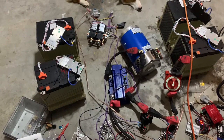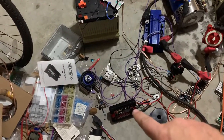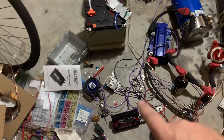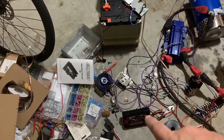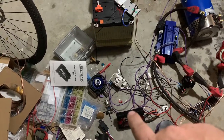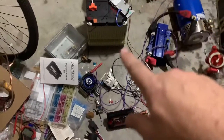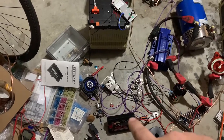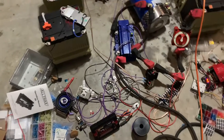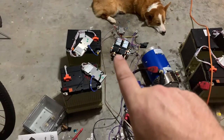The next step — I need a wire going from here over to the forward and reverse switch, and I also need both forward and reverse going to the potentiometer. But I can't have the two wires connected in any way that would always make it go in reverse or always forward. Basically what I need is two diodes so that the forward and reverse lines coming over to this don't connect to each other. Then that will be the full system once I get the two diodes.